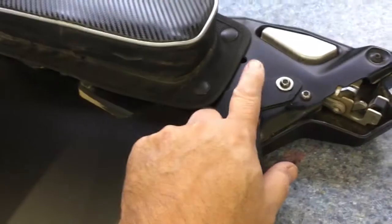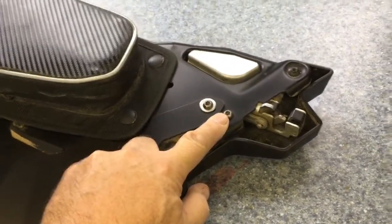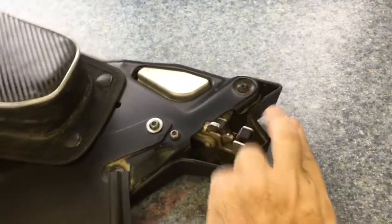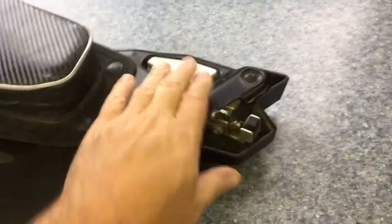To test fit the new-to-me S doors, I don't need to put the latch on, but if I want to test fit my UTV Giant lowers, I'm going to need to bolt them there. So for the sake of 2 bolts, I'm just going to pop out this latch. What I'm going to do is remove this bolt so I can pull the plastic away from the door a little bit, separate that. Remove these 2 bolts. That latch will pop right out.